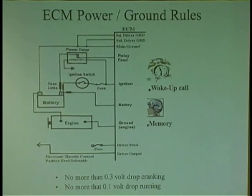And back then, you could take the purple white wire with a test light and the positive side battery. You're not going to hurt nothing. You could do a scratch test. You go, tit, tit, tit, no injector pulse with the key on. And meanwhile, you can communicate to it. I'm talking to the computer. I'm like, dude, what's your problem? What are your needs? So I'm like, TPS is not at wide open throttle. You have RPM signal, because I already checked it with a scope. And so what are your needs?